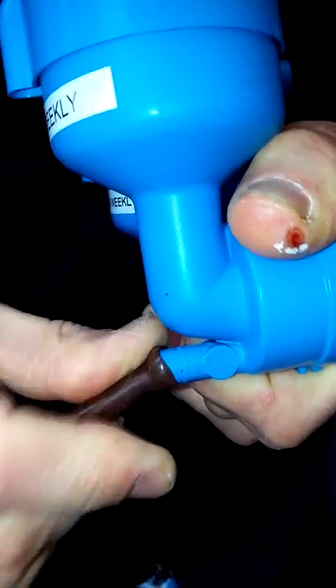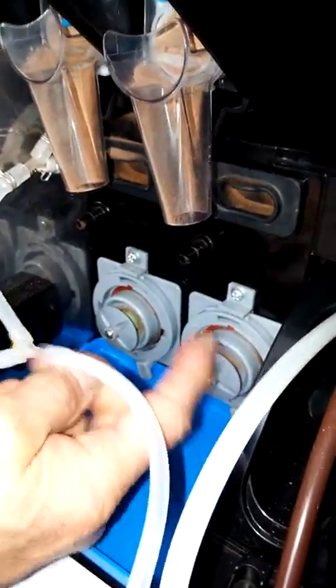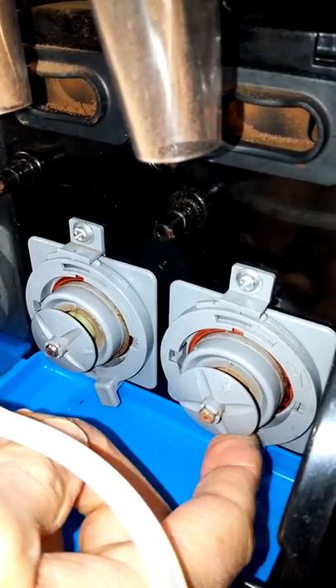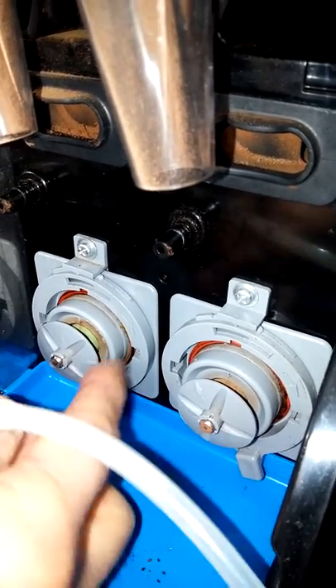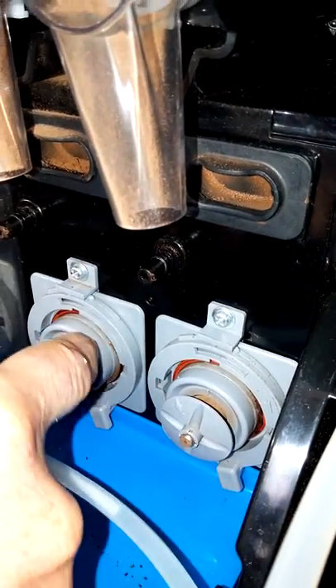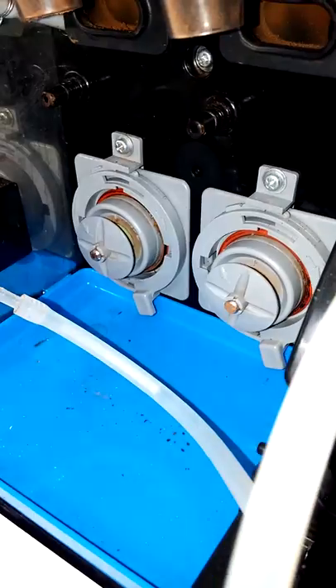Re-insert the tube by pushing onto the bowl. Also check the cleanliness of the motors — these are the mixing motors — and make sure these are spinning freely. If these are dirty, add warm water and rinse with a brush into the tray, which will go into the drip tray.